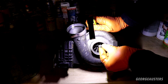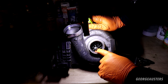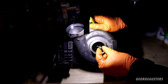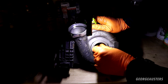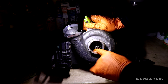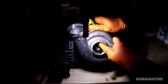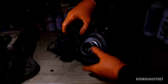This is a catastrophic turbocharger failure - it needs a new core, and then potentially it's good to go again. But it's made a bit of a mess of the housing as well. As the shaft let go, this obviously continued to spin and those fins were making contact with the housing, chipping away at it. With a cleanup and grinding back to a smooth surface, it could possibly be fine.